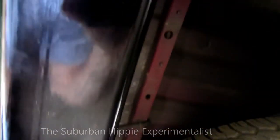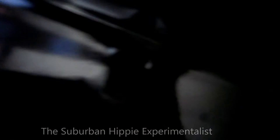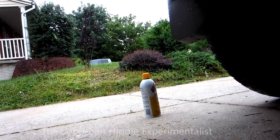I got my Curt tow hitch today. To get it up into the tall truck, I lifted up one end with my hand, put the other end on my knee, and held it up while feeding this one bolt in here without a washer — I just want to hold the hitch in there level so I can bolt it up. I sprayed Liquid Wrench on the threads since this truck hasn't had a hitch before.